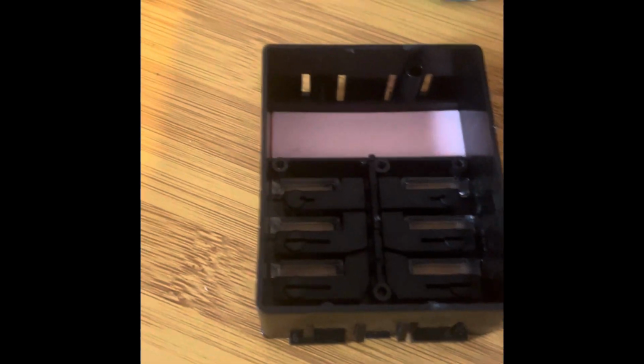So this is the new LED screen. I don't know if you can tell, but there's a ridge, and that ridge needs to be facing up when we drop it back in to the bigger plastic piece, because that's what needs to touch that foam piece right there. So let's try to do that. Following the LED screen, I put the orange shield. I'm gonna add the white shield afterwards, and then we're gonna drop the white plastic piece in last.